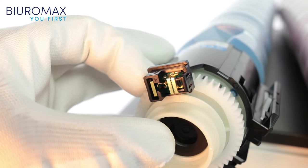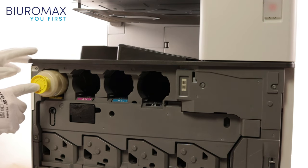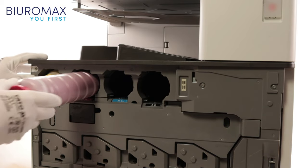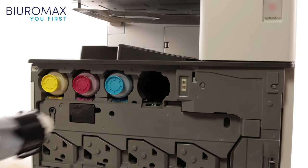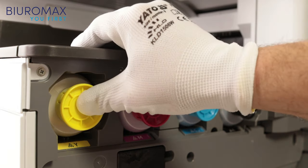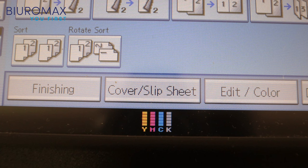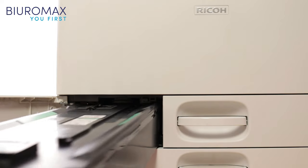The test toners are installed in the copier. There is some resistance when inserting the toners, but the manufacturer assures in the instructions that this is normal. Continue to push the toner in after the first click sound until you hear the second click. After installation, make sure that all cartridges are fully inserted. Otherwise, the copier may display a toner installation error. The photocopier correctly shows the level of all toners and is ready to copy. A new empty waste toner box weighs 531 grams. The box will be weighed after the test is complete.